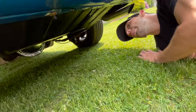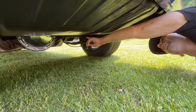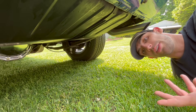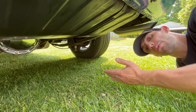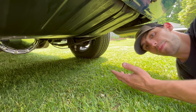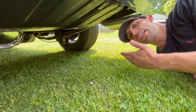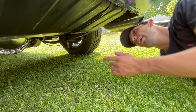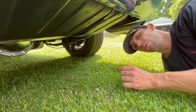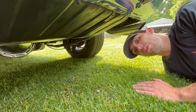Underneath the car we can see the 12-bolt rear end, which is correct. The numbers for the 12-bolt are on the other side. The standard 12-bolt that came on a Z28 would be a BO code — a 373 non-posi-gear, though those are pretty rare. The common one is a BU code, which is your 373 posi-gears that came with stickers in the trunk and a tag on the unit itself. A lot of people also chose the 410 gears, which would be a BV code. This one is just a BU code.